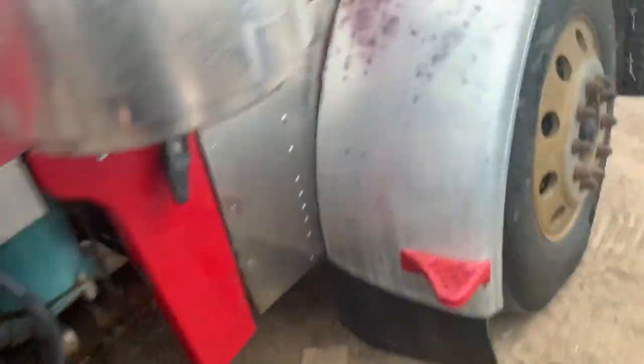I had to do a little bush fix here because I actually ordered the proper fuel line to go down to the tank, but it won't be here for weeks — it's kind of hard to get. So my bush fix: I carefully drilled at an angle into this plug — it's a 5/32 or 3/16 line, I can't remember — and I put the fuel line right in there. I want to say it's a little more than half tank. I'm just going to seal up the top of this with some butyl and honestly it might work forever.